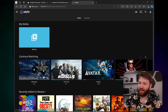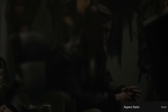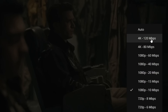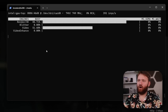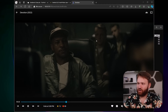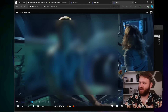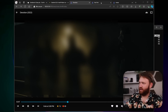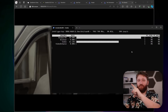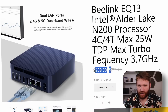This is my active Jellyfin instance with Intel GPU Top running. All the videos I was recently playing are 4K files — for example, a 4K 120 Mbps file transcoded down to 10 Mbps for mobile viewing. You can see it's working hard but there's absolutely no stuttering in the actual media playback. It can handle three simultaneous 4K transcoding streams. Opening a fourth causes stuttering, but if you drop streams down to 720p at 4 Mbps, this little mini PC can handle five continuous streams transcoding from 4K to 720p. At $259, it's a little beast.